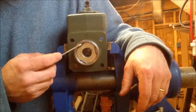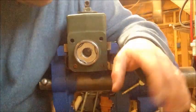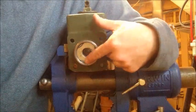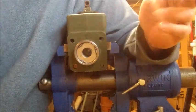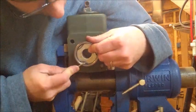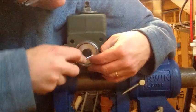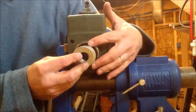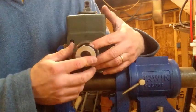Right here, these three dimples you see are part of a spring clip. It's real easy to get off — there's about an eighth of an inch gap in between there. However, this washer and plunger set does have a spring behind it. It should not come flying out at you, but there's always that possibility it'll move. So you take your pick or flathead screwdriver, get down in the groove, and start lifting the spring out. Got one side out already. Try not to lose it — not too heavily spring loaded. You've got a washer.